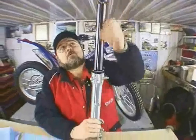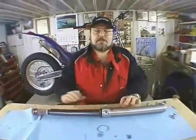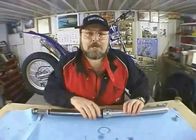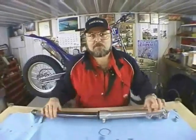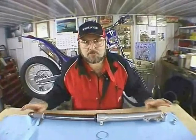The amount of oil you will put back in this fork is 300 cc's — that is 300 cc's on either side, right or left. The proper weight is 7-weight fork oil. Note that 300 cc's is after this fork has been disassembled and completely drained and cleaned.